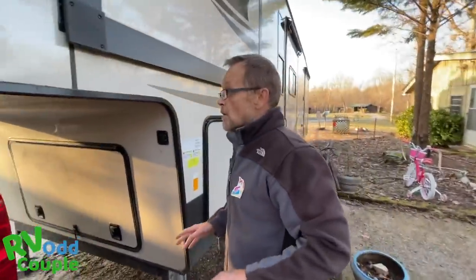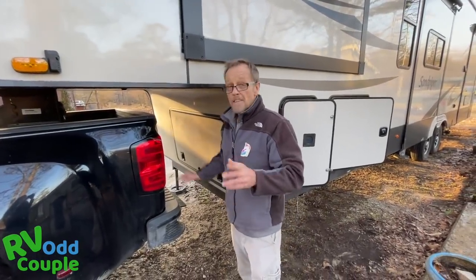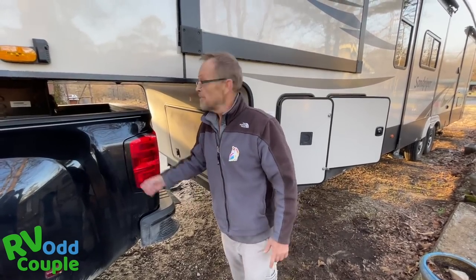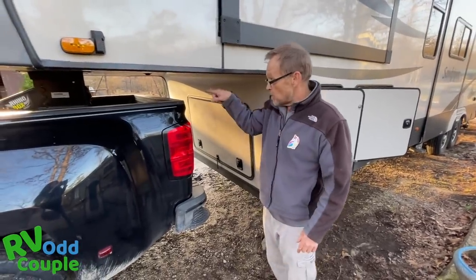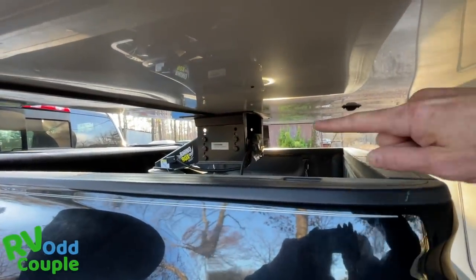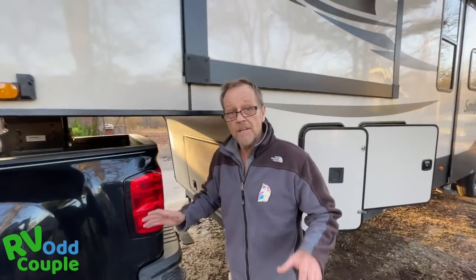Now I'm going to release before I open my gate. In the past I've always dropped my gate right away so I don't forget before I pull the truck away. But if anything went wrong at this point — if my chocks fail — the back of the truck will stop the RV from rolling. That's kind of what saved the day last time. And as you can see, the only damage the RV took is that box right there — it completely smashed up. My suggestion is don't drop your gate yet, because your gate could still be a backup safety measure.